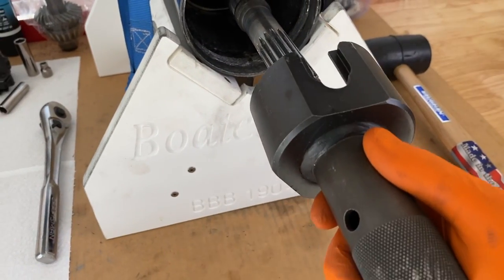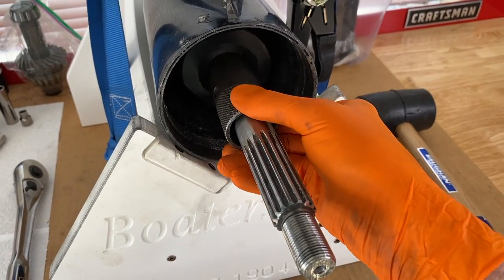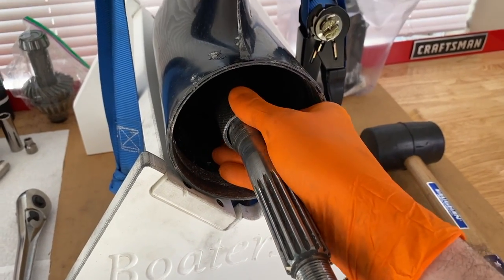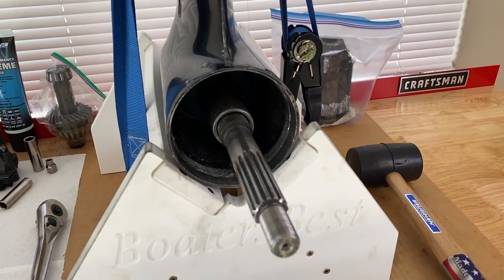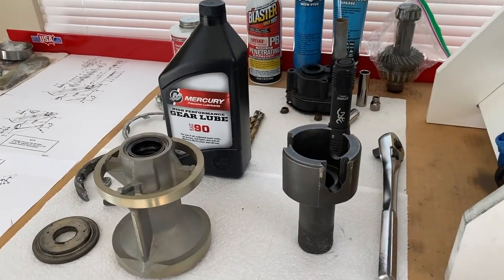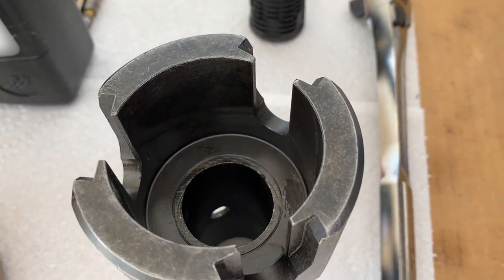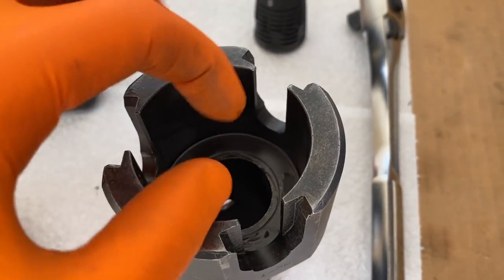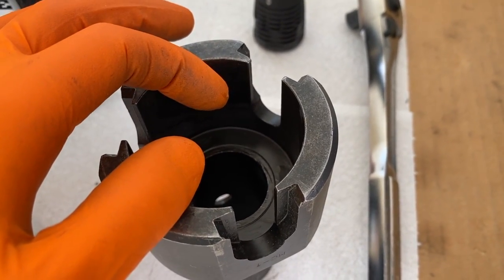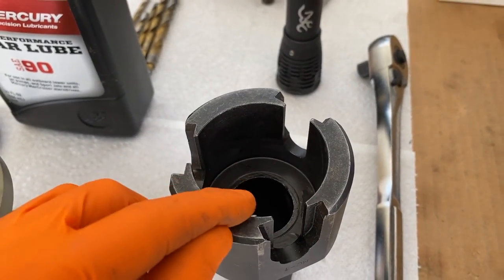What I'll have to do is pull up on the drive shaft to properly seat that tool on the pinion gear nut — I definitely do not want to leave this part out. I grabbed some gear lube and lubricated the entire inner portion, because your entire clutch dog is going to slide into this area. If your clutch dog is not lubricated with gear lube, it'll be a tight fit — so again, an important step.